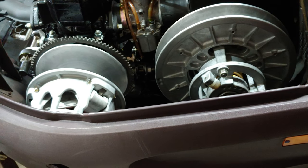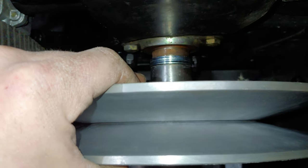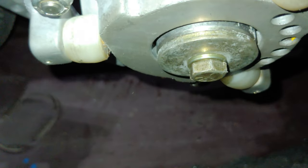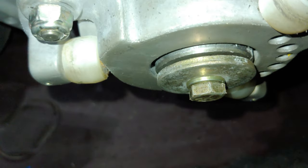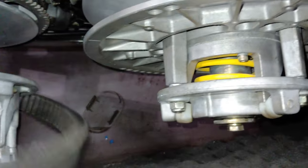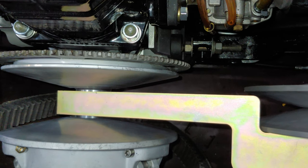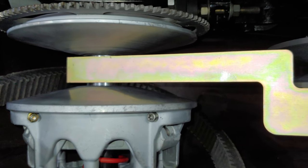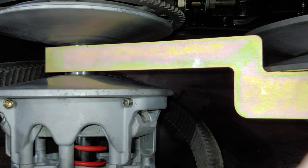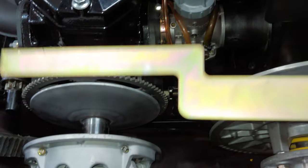Technically you should warm it up, take it for a spin, then come back, loosen it, and tighten it again to 55 foot-pounds. But usually torquing down to 55, loosening the bolt, and torquing to 55 again does the trick. Those clutches turned out nice. Got it on there with good movement back and forth - the alignment looks great.